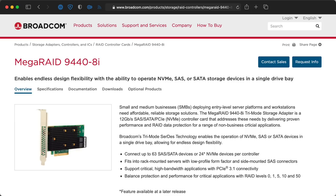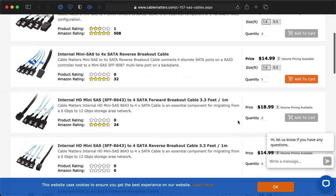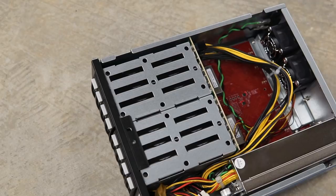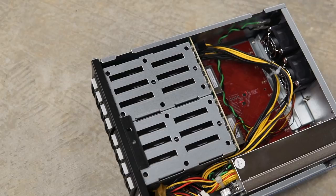To wrap this up, I finally got true hardware SAS RAID running on the Raspberry Pi. That honor actually belongs to Josh, who got the whole setup running on 32-bit Pi OS before me. Am I going to recommend you go buy this $1,000 storage controller for a homemade Pi-based NAS? Maybe not. But if you do want high-end storage on the Pi, there is a lower-end version — the 9440-8i — which should still work and is less than $200 used. Even that might be overkill if you just want a cheap NAS with only SATA drives. I'll be covering a more inexpensive NAS setup this month and going into more depth on new storage standards on the Pi in upcoming videos, so make sure you subscribe. And if I can get 2.5 gigabit networking working with a new power supply, I'd love to see if there's a way to contain that, the storage controller, and the Compute Module 4 all inside a storage backplane like this one.